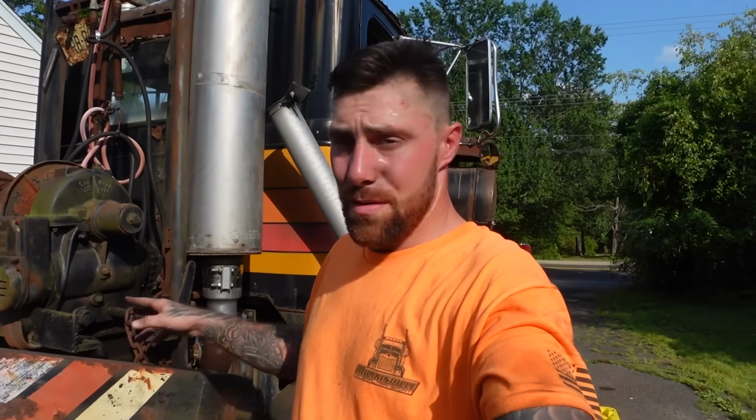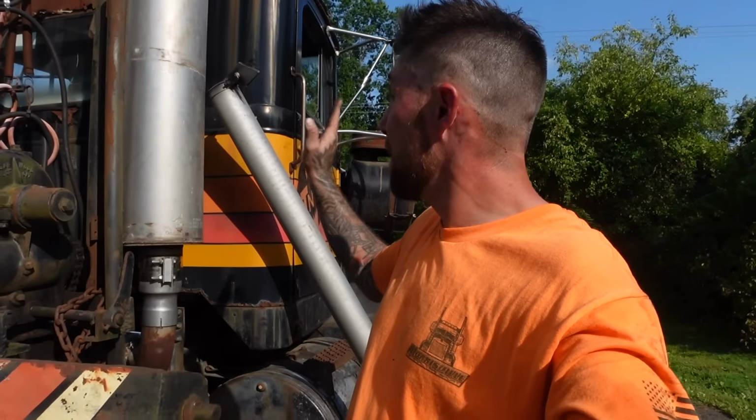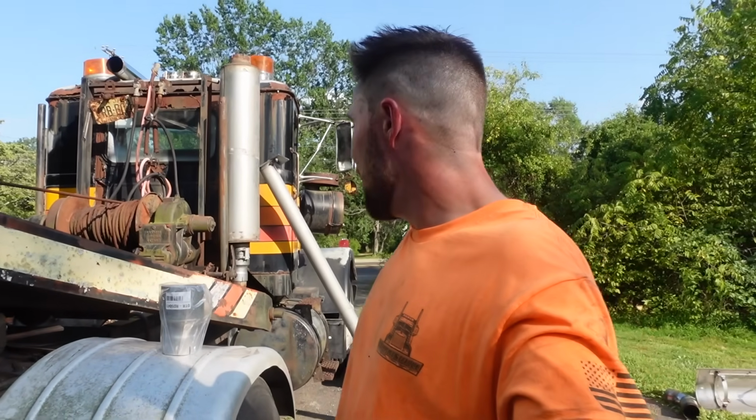I can't mount the bottom with this like little U-clamp deal like normal. I can't mount the top because it doesn't line up where it used to for the clamp to grab the little hook thing. So I'm gonna probably go to AutoZone that's like 5 minutes away and get one of them universal little muffler strap deals. It's got a bunch of holes in it. Like somebody called it like plumber hanger metal stuff. Anyway, I'm gonna wrap that somewhere and bolt it to hold the muffler on, because right now that's holding the muffler straight up. It's gonna fall over. But either way, it's gonna work. It's not what I wanted, it's not the right stuff, but in a few hours, it's all I can come up with. It's been a very long week, a lot of hours, rough week, and it's all I got.